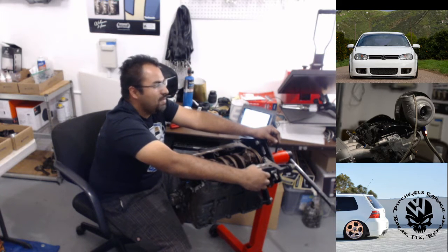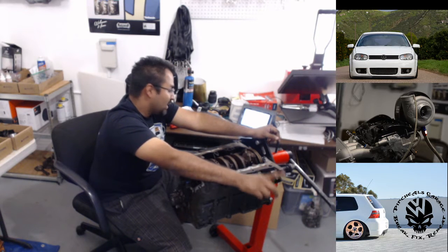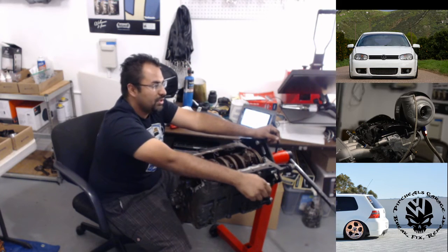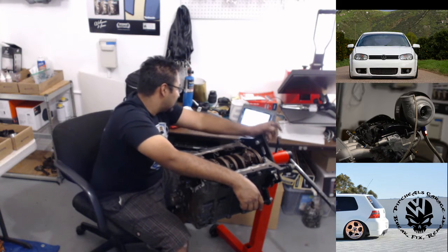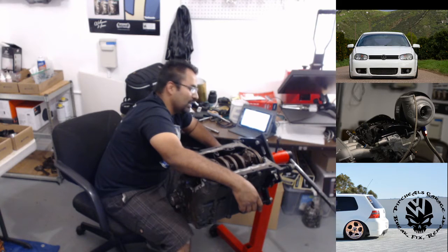Did you use one of those cheap eBay catch cans without a baffle in it? That's another question, because a lot of people use those cheap $20, $40 catch cans, and if they don't have a baffle in it, you're literally just dumping oil back in, and it'll burn, it'll smoke too. I'm waiting for your answer, Eddie. Or did you actually get a brand name or a high quality catch can? Interesting. That's really odd, man. I wish I could give you a legitimate answer, but that's really odd.